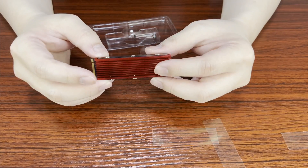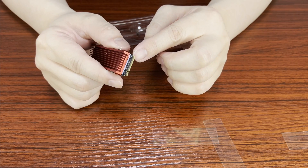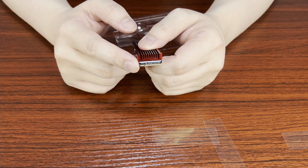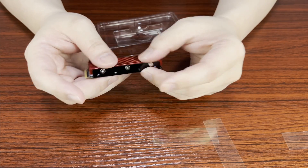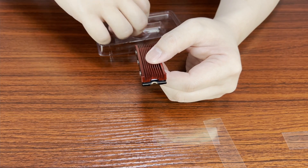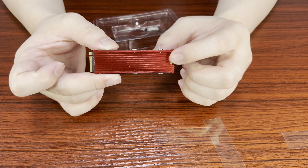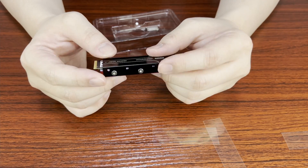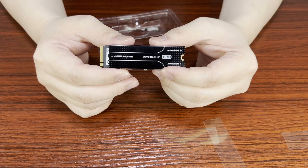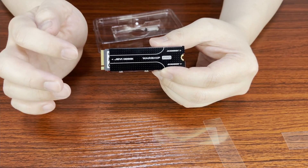I'm done with the installation of the heatsink to the SSD. As you can see, this is where the terminals are that you'll connect to your computer or PS5. Make sure you are oriented correctly — the small pin should be on the right side. Make sure these holes are correctly aligned so that when you install it, you won't have any problem. Just some very simple steps on how to install a generic heatsink to an SSD enclosure. Stay tuned to my next video if you want to know how to install this in the PS5 and configure it so the PS5 recognizes the SSD drive.